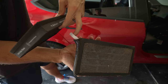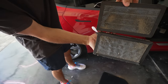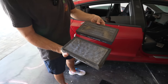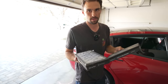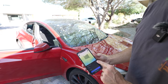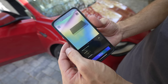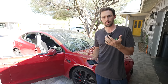Here are the filters we just pulled out — they are filthy. The great thing is the kit gives directions on how to install them. They have tabs because the filters stack on top of each other — you have to pull the bottom one up and then pull it out, and those tabs are the only way to do that. The air conditioning has to work extra hard with dirty filters. We noticed Tesla's own filters are $17 each, so $34 for two — the same cost as this kit, which comes with tools and HEPA activated filters instead of paper.